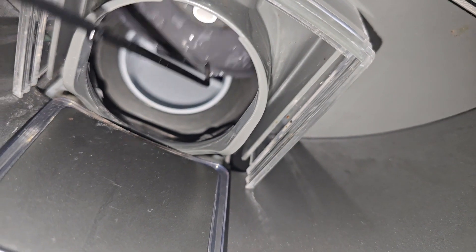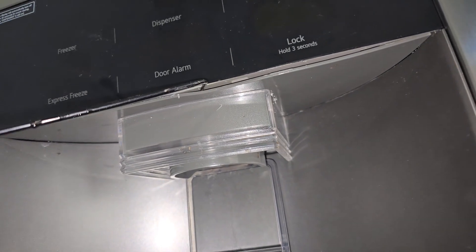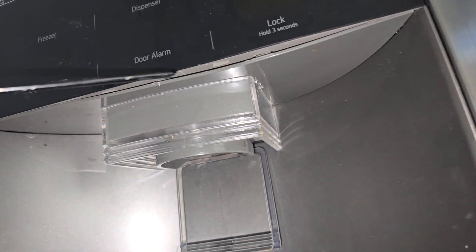Confirm that by grabbing a pick and just opening the ice flap manually. There's no damaged plastic and it's opening smooth like it should. That leads me to believe it's more of an electrical fault.